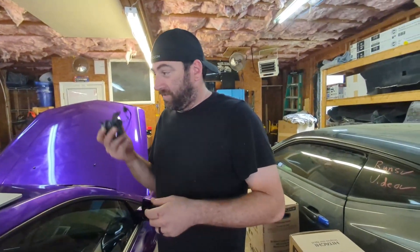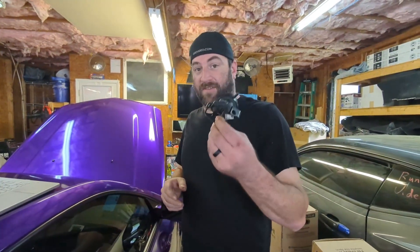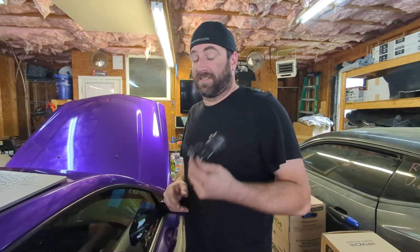Just wanted to make that quick video: if you have a big cam, pay attention to your engine vacuum. If you're not making stock vacuum, get rid of the stock valve and get the low-vacuum valve on there. Craig at Kong has them on the shelf — just order and put them on. It's $200 and you can almost guarantee you're not going to blow a snout off the car. That's it.